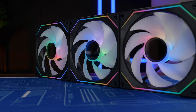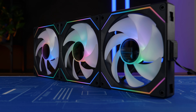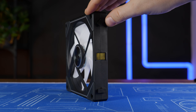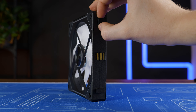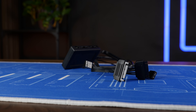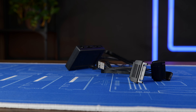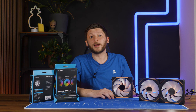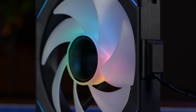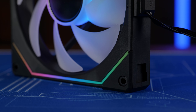The proprietary connection system is back too. Instead of running each fan with individual PWM and RGB cables, you can daisy chain these into blocks by pressing them together and use one of those proprietary cables to connect them to Lian Li's controller. Don't forget to remove the two holders on the last one by just twisting and pulling them out. You need to give it two SATA powers — although you just need one, the other is for more than 12 fans — then connect to a motherboard using a 3-pin ARGB and 4-pin PWM cable, plus an internal USB connection. Once done with all the cabling you can use Lian Li's L-Connect software, which got my 'does not annoy me' award — the first and still only software to do so.